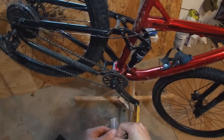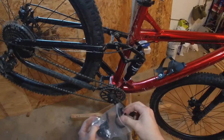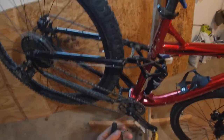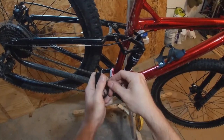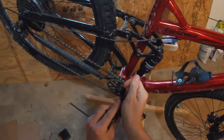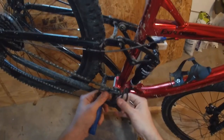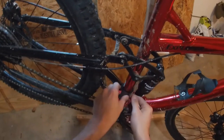I don't need the extra bolts right now, I'll set them aside. What I do need first is the collar to attach to the seat tube. These are all aluminum parts, which is really nice — the one that came on the bike was plastic, which is probably why it broke. The only tools you need for this are a four millimeter and a three millimeter Allen key. I'm going to attach the collar to the seat post, and I don't want this to be very tight — I want it to be able to slide around so I can adjust it to get the fit that I want.